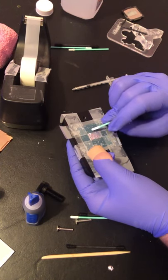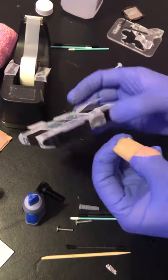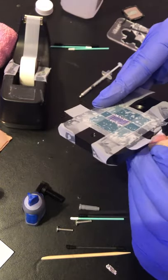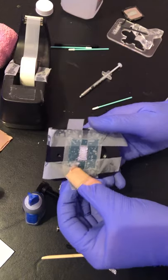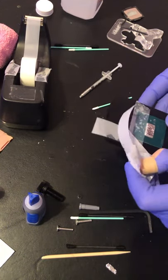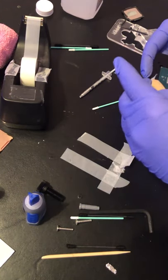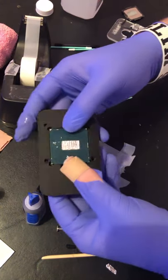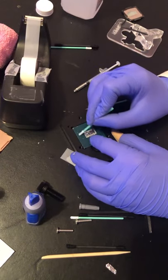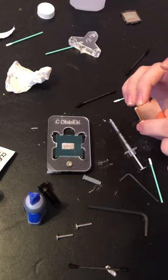I'm going to go ahead and spoil it for you — it got everywhere, it started showing up in places. I even checked to see if it dried two hours later and it hadn't, and I got worried because it was all over my hands. So I start to take off the tape, which I'm not good at either. Then I notice something — up there at the top I clearly have liquid metal on the PCB part, and yeah, that can be a problem because it's highly conductive. So I spend the next hour or so trying to clean that off. I stopped focusing on the camera because I put a Q-tip to it and smeared it. I took paper towel to it — you can see it smear in the video. At this point I've decided, fuck it, let's just keep going.